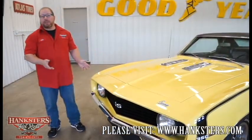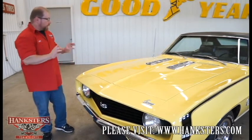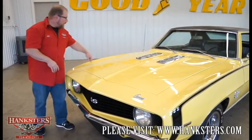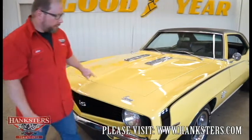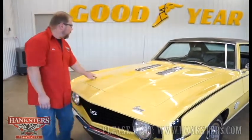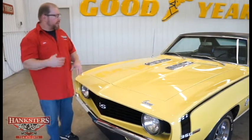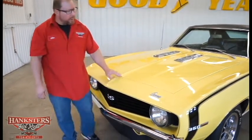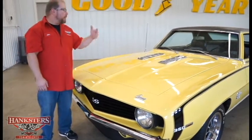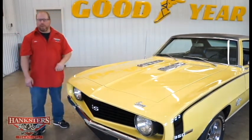Around to the front of the 69 Camaro SS style car. Working from top down: we've got the SS hood with the SS grilles on top — all steel. The hood gaps all the way around are very uniform — front, back, and both sides. Fender-to-hood elevations are not too bad; you have some adjustability with the hinges and bumps to fine-tune things. The windshield is very nice with no cracks or chips, and all the bright trim around it is in really good shape.